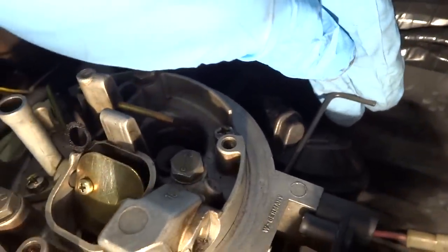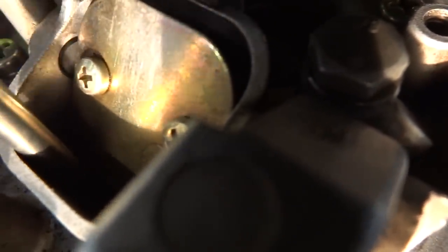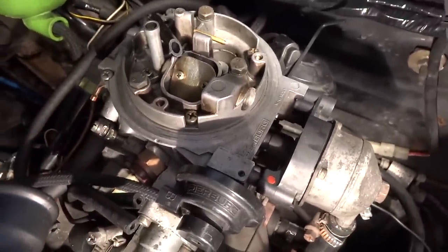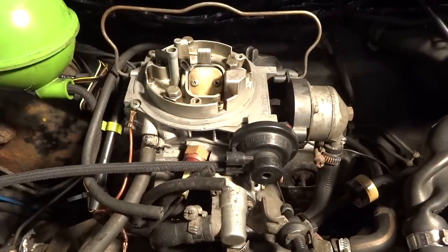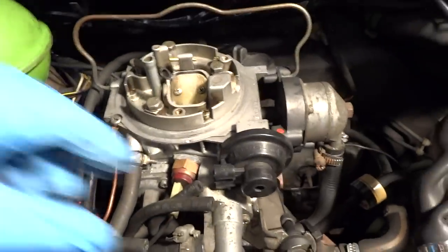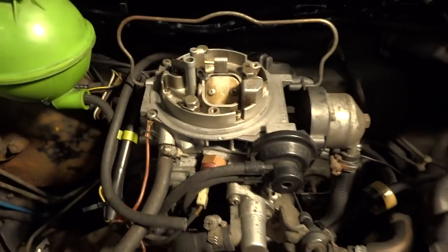Just press on this and it should open. Using two hands I could keep it open — I'll just try my little finger on the end. Put this down the front and that is a perfect 4.9 gap for me on this car. If it needs adjusting, rotate the allen key. So that's the choke set. Don't forget before you put the air filter box back on — remove the loose tube and reconnect the carburettor tubes onto A and B before you put the filter box back.